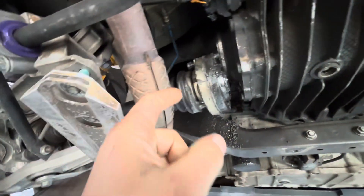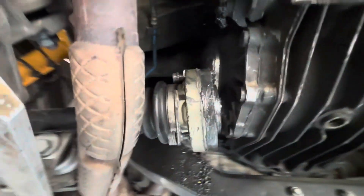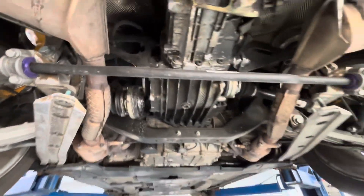The little steel cup on the inside of the axle — the one that goes here — is going to have to be replaced. Some of the bolts are missing and bent. I'm going to replace all the bolts along with these little plates here, and replace the flange because the threads are damaged and I don't want to risk messing with those. It's a pretty thin flange, so torque it all up properly and it should be good.